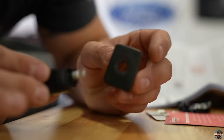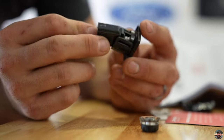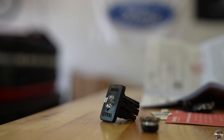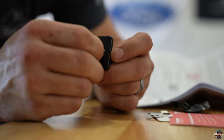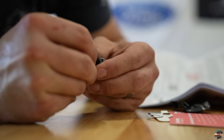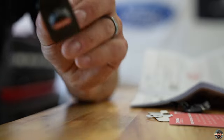Here are the switch components: a plastic lock nut, the switch, the bezel, and the exterior decorative knob. This can only fit in one way — it has a round upper that slides in, then the lock nut goes on. It's plastic so it doesn't need to be too tight. Once it's in, turn it all the way so that 10 is at the top of the indicator — zero all the way to the left, 10 all the way up.